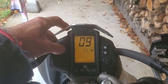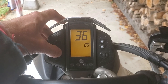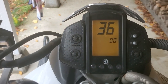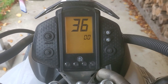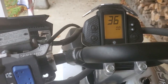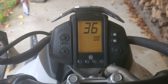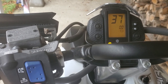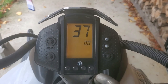We're going to move on to mode 36 and 37. When we get to 36, we're going to hit the hand warmer switch at the bottom and you're going to see it cycle five times. We're going to do that twice. Each time we press this button we are priming fuel by clicking open that injector for cylinder number one on mode 36. Then we move up one more to mode 37 and click that one too — we're pumping gas straight into that intake manifold right now. This is the priming procedure; it's pretty easy.